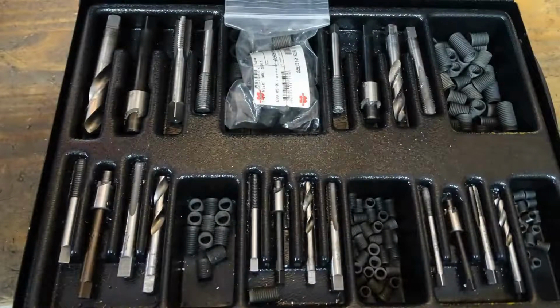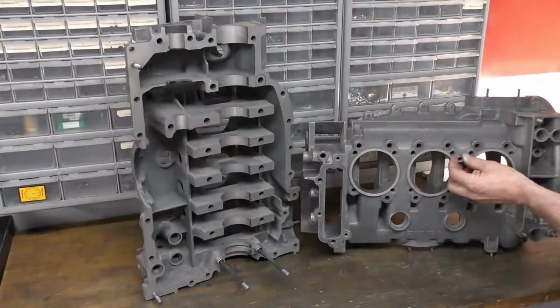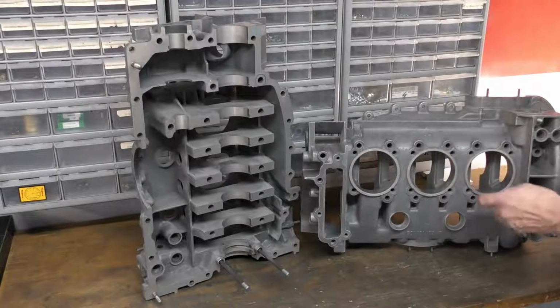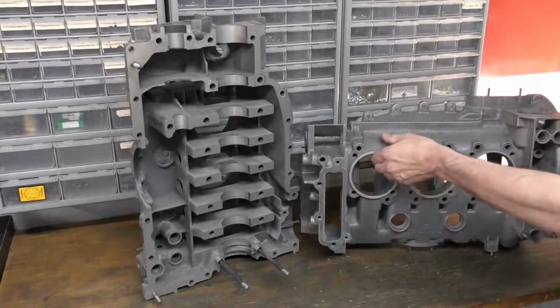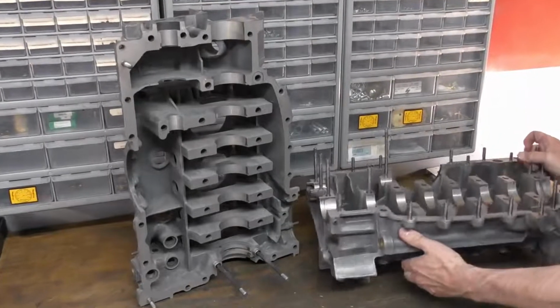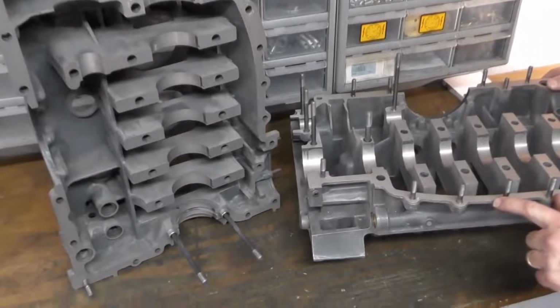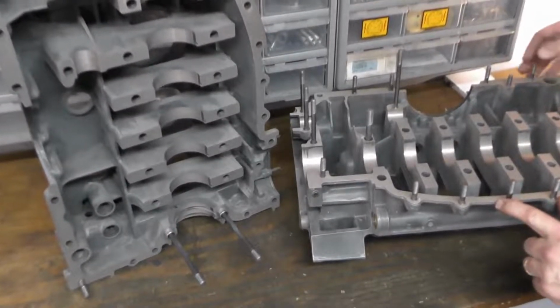The special installer has a taper to it, so as you screw it in and the insert bottoms out, the installer will expand the insert out against the metal, therefore giving it 100% surface retention instead of relying on just the threads. Now, Time-Serts are used throughout the entire crankcase, not just the head stud. Even on our case surround bolts, anywhere where it needs thread repair.